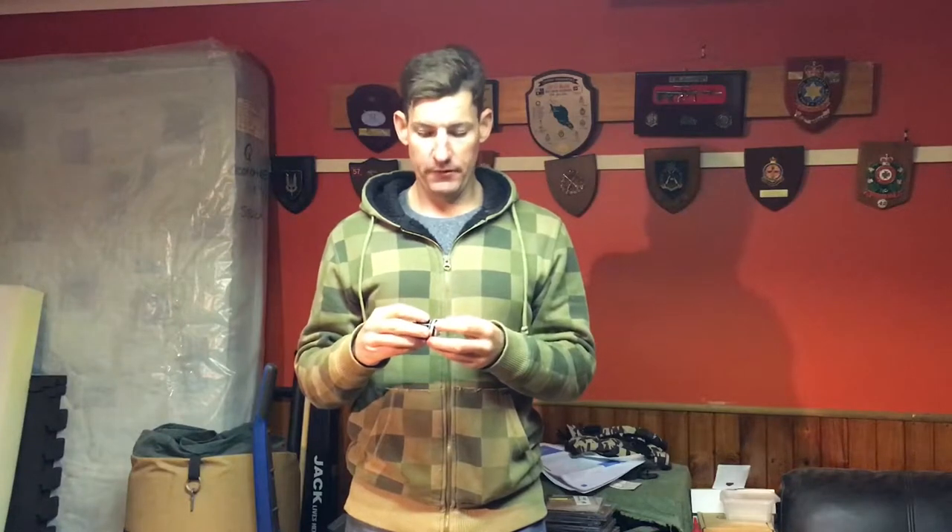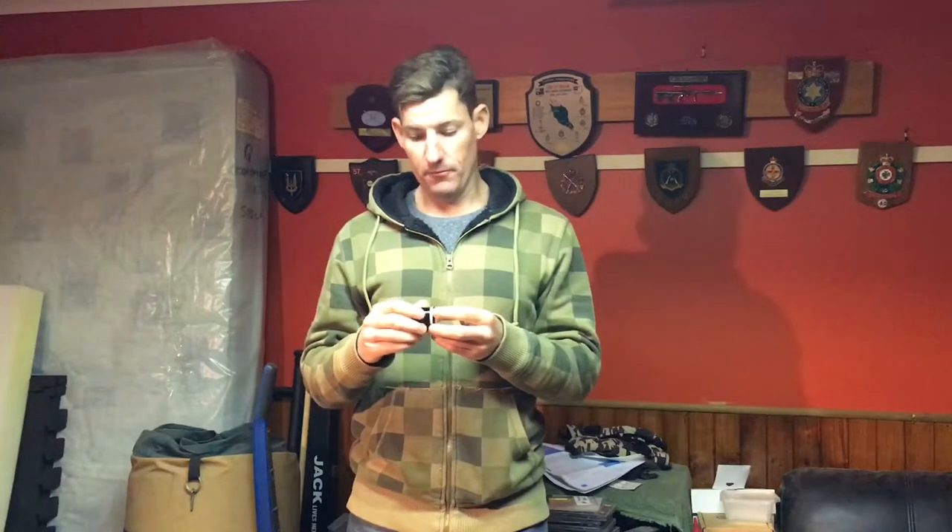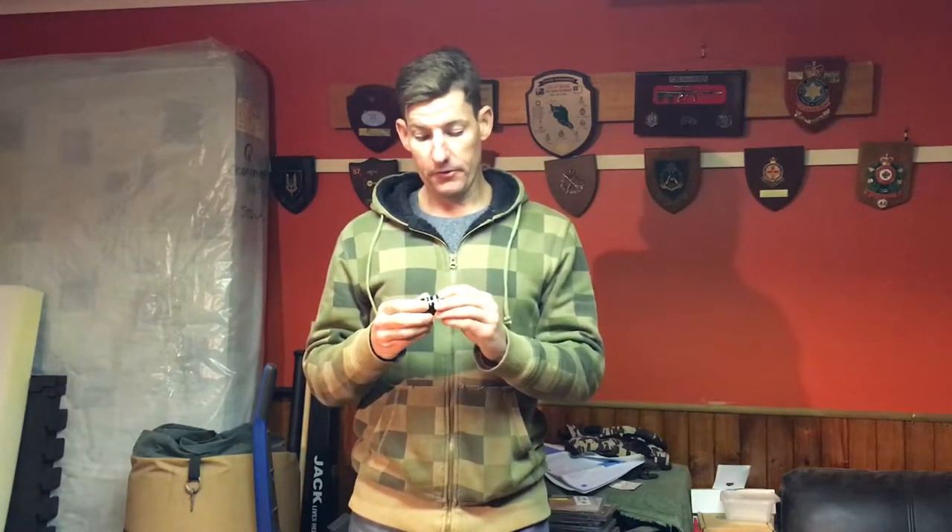It fits the 36, the 34, the RockShox Lyric, and the Pike — all that stuff pre-Debonair on the Lyrics and the Pikes. It doesn't work with the Debonair due to a different style attachment on the spring. The Debonair is quite a good size already, and the Evol on the 36 is quite a good size as well, which is part of why I took this out.